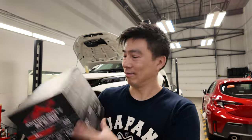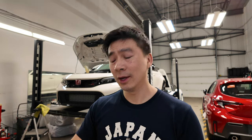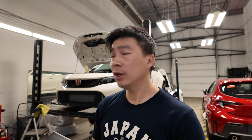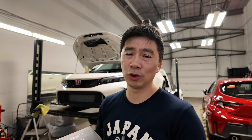And you never have that problem of your battery dying ever again — so you never miss a car meet or a cruise with your buddies. And on top of that, if you want to go full out, you can get the Anti-Gravity ATX 30. This battery is half the size but it puts out way more cold cranks than the actual factory battery. The reserve on it says on the box 32 amp hours — realistically I think 16, but that's more than enough to run your car during the summertime, AC and everything, with half the size. You could go with group 51, way more amp hours — I believe that's 70 amp hours. It's a little bit bigger than this one but double the price. So we're going to go with this one — it's half the price, half the weight. Let's go ahead and yank that battery out and weigh these two.